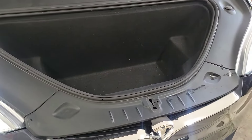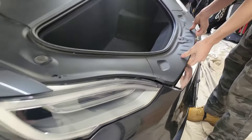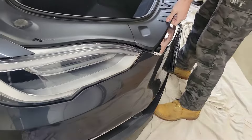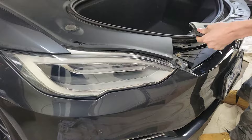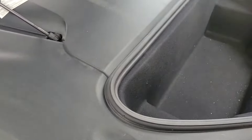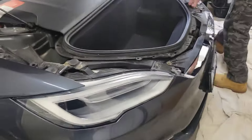So what we have to do first is take off the covers here. I haven't done this before, but what has to happen is you actually have to take the bumper off to get at the light and the bolts. This one's pretty easy to snap off — you just have to take all of them off. There's a little rubber padding there, but it just comes off right over the padding. Pretty easy — did it myself with one hand.